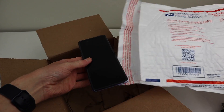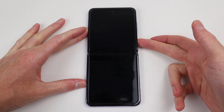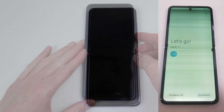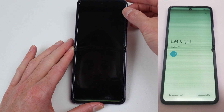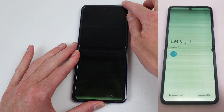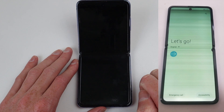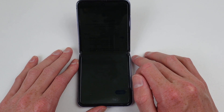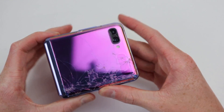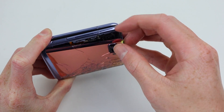Included was nothing more than the phone itself. Powering up the phone, I felt a vibration but no picture appeared. This phone was described as having a discoloured screen that goes black, so this was expected. I couldn't get the display to light up properly enough for the camera to see it, but in the listing photos you can see two black blobs at the point where the display folds. These fractures to the display are what has killed the screen.